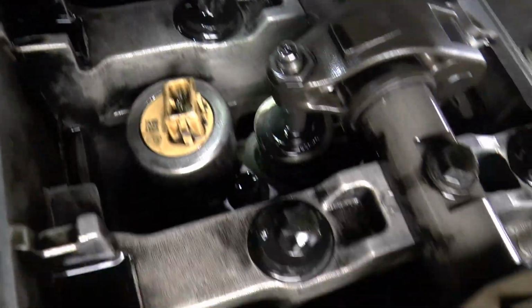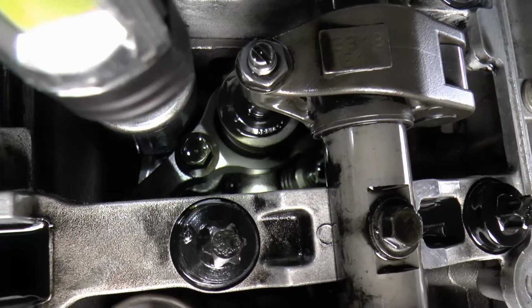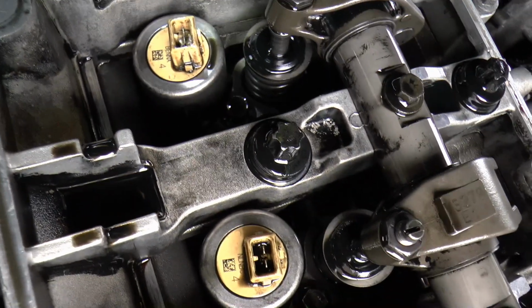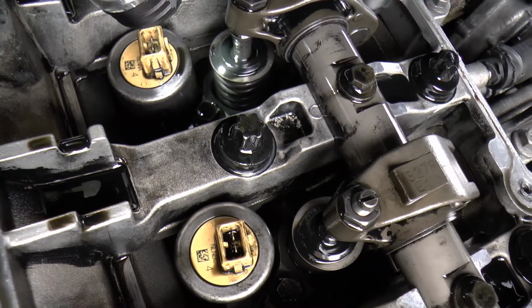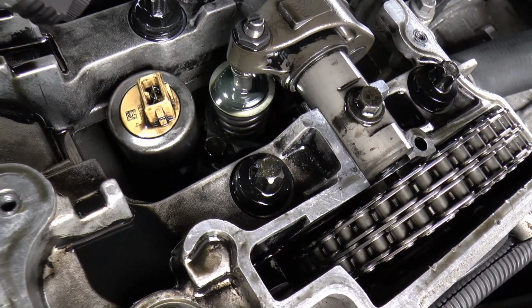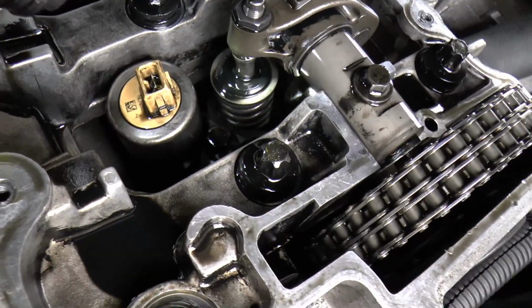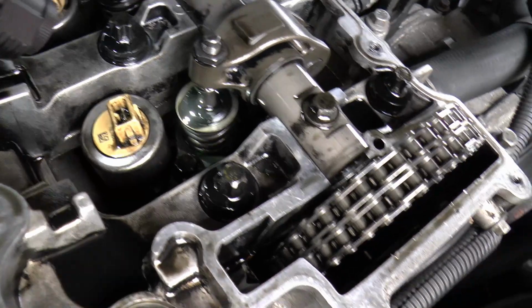I was wondering if you could see any diesel. You can tell which one's leaking. With the early engines like this one, if this injector seal job doesn't stop the oil level rising, then either the head's cracked or I've made a pig's ear of it.